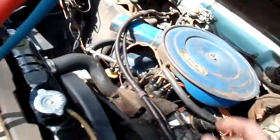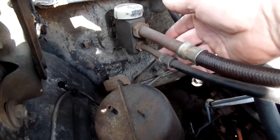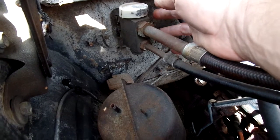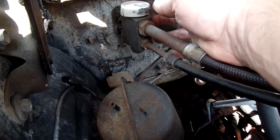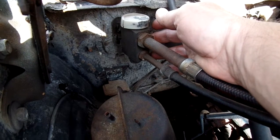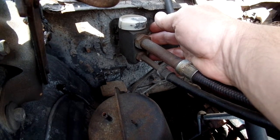It then goes over to the firewall. First it goes through an expansion valve, which adjusts the size of the orifice of the incoming liquid refrigerant, which is the smaller line. This is the return. This adjusts the size of the orifice in the evaporator depending on how hot the cabin is inside. So the hotter it is, the bigger the orifice is, so that the efficiency of the evaporator is increased, because you want the evaporator to have evaporation from the top to the very bottom.